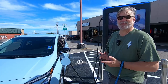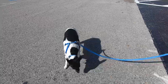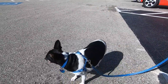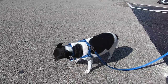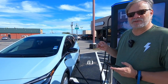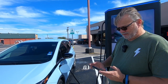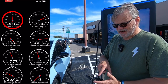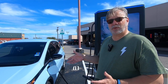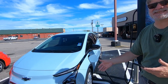We just went a little over eight kilowatts there. About four minutes into our 10-minute charge on the Bolt — for those familiar with electricity this will make sense — when we were plugging in the Fiat, the charger had a current a little over 28 amps, giving around 4.3 to 4.4 kilowatts to the battery. The Bolt on the other hand is running around 47.8 to 48 amps, delivering 7.7 to 8.2 kilowatts going in — almost twice as fast on a level 2 charger.